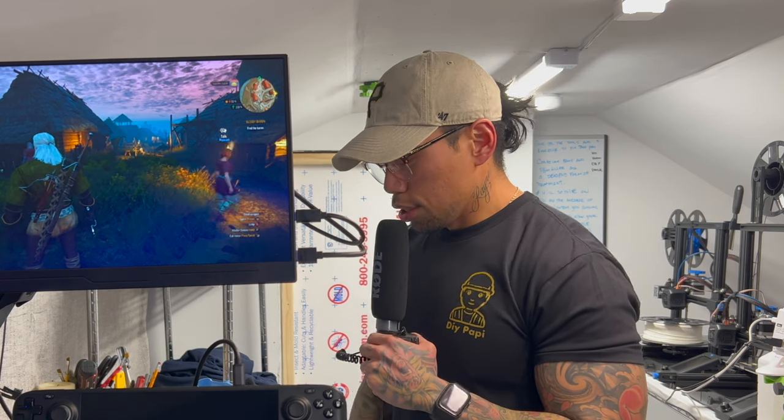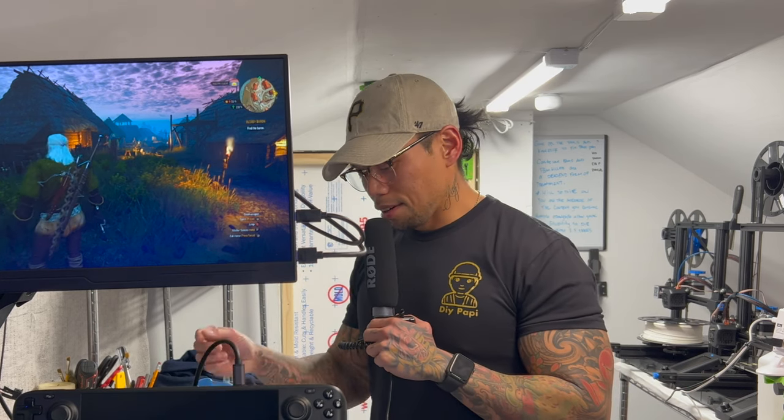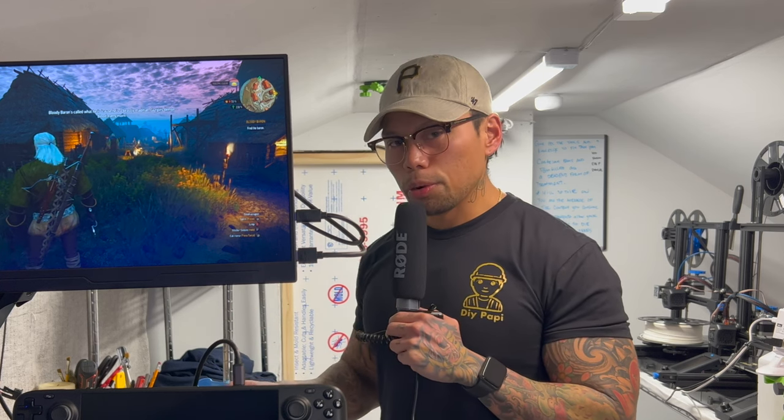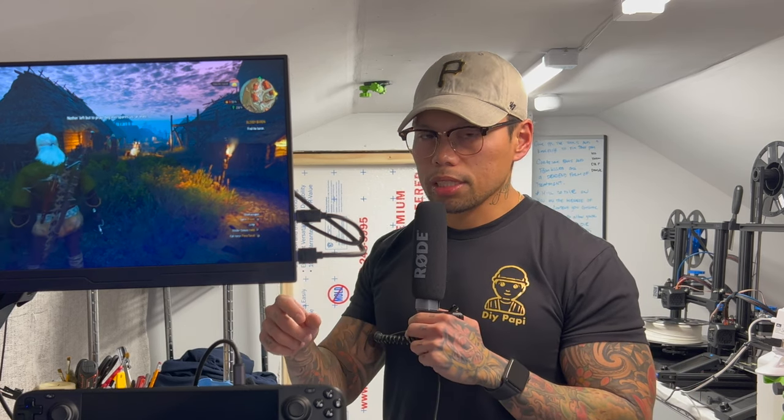If you are going to get this mod, your best bang for your buck — temperature and noise wise — is medium settings on the fan, docked. You'll get 70-71°C with a fan RPM of 3800. Really good temps with really low fan speeds. You'll definitely be able to play the Steam Deck without headphones, according to my data. But if you normally do not play your Steam Deck docked — I rarely ever play mine docked — do not do this particular mod. It's too much hassle and extra money.